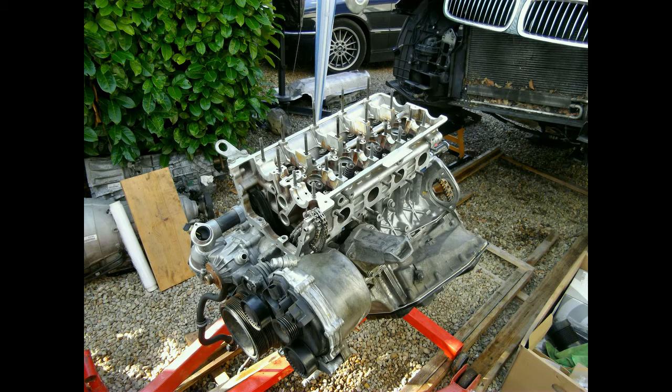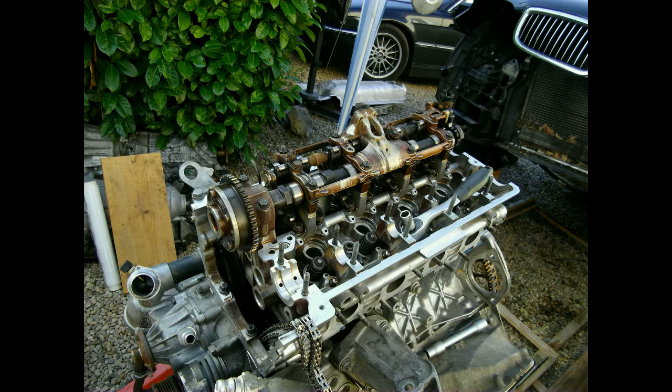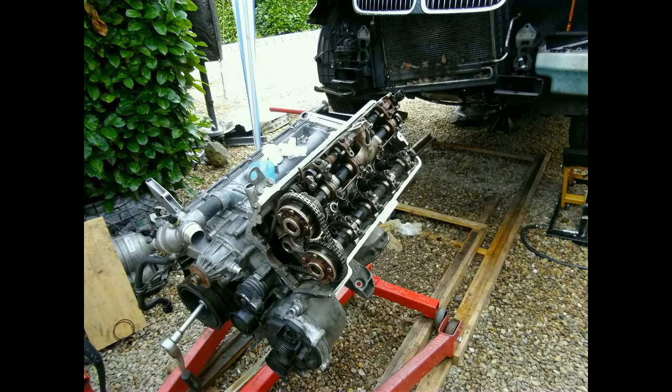The first cylinder head is in place, not bolted down yet. I turned the engine so the head is horizontal — I absolutely do not want the head to fall off while getting the head bolts ready. Note both cams are still out because the head bolts are located right under them. New head bolts go in — when you torque them down they stretch, so you must use new ones. First pass from the middle in a criss-cross pattern: 30 Nm or about 22 ft-lbs, then 90 degrees twice. Installed the valvetronic unit — the inlet camshaft is integrated in this unit and you do not need new bolts. Be sure the lobes are positioned so not a single valve is open. Exhaust cam installed; for the caps you do need new bolts because they are the stretchy kind as well.